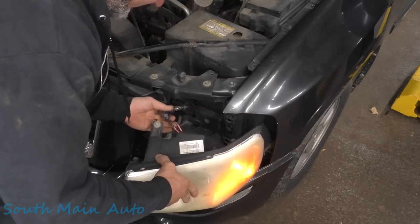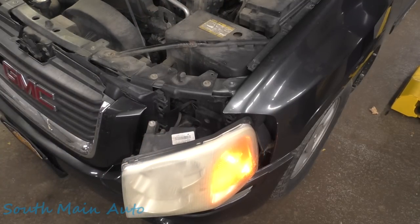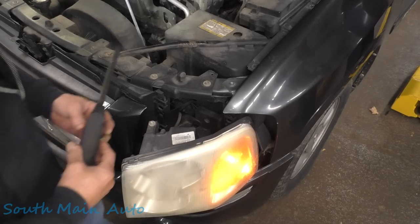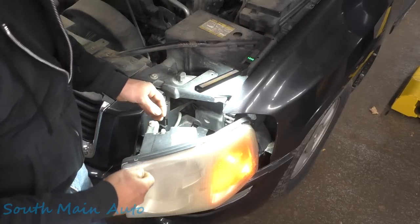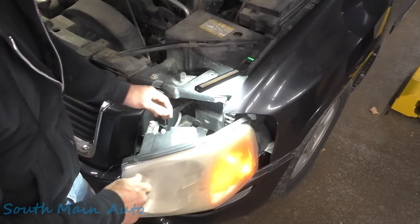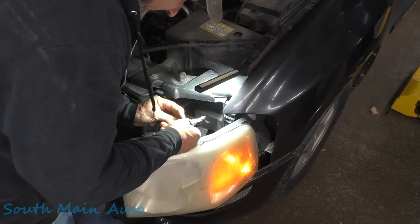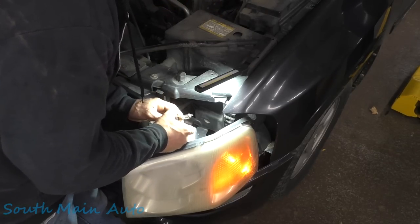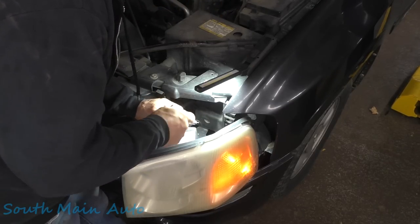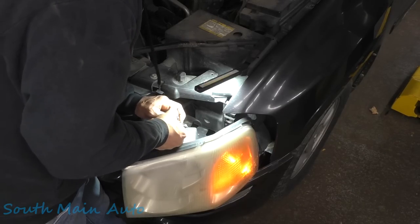This one's got a couple of butt connectors on it. He would leave his door open and his battery would go dead. He'd throw the jumper on it — at that time we didn't really have jump packs, we had battery chargers — and he'd put it on nuclear. When he would turn the key on, of course all the lights would come on. 18, 19 volts, whatever it was charging that dead battery at, it blew everything.